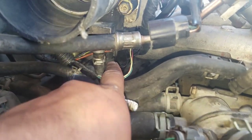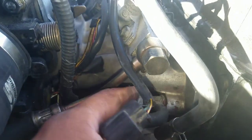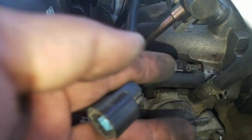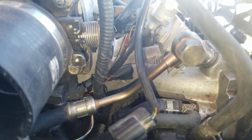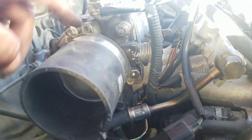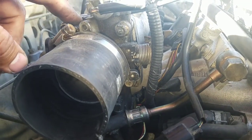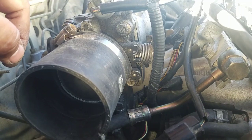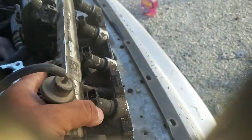The back line is too short, so you need to run that line all the way down to the water line that goes underneath the intake manifold. You won't be able to see it now but you'll see it when you take this out. You also want new gaskets — use the Y7 intake manifold gasket along with the Y7 throttle body gasket.